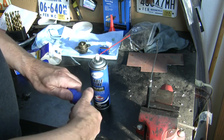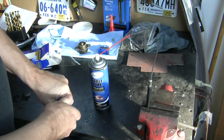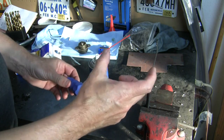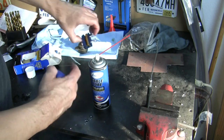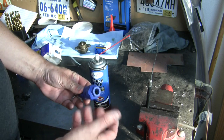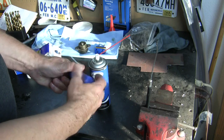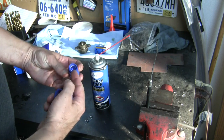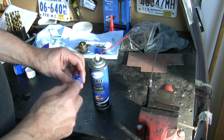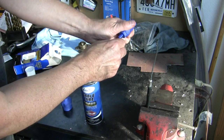Nice construction. Kind of a similar idea, except instead of crushing the rubber, call it a grommet, around the end of the cable with two screws this direction, it's using more of like a compression fitting, like you know, in pipe. And so yeah, you've got a little narrowing passage there, and there's a little reservoir in here, and here's a little hole on this end that your cable lube tube will fit down in.